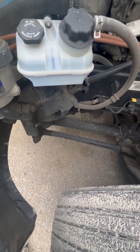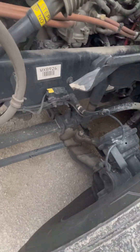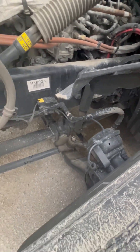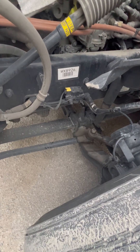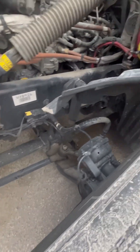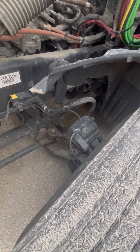I have my front and back spring mounts, my leaf spring, my u-bolts, and my shock absorber — all properly mounted, secured, not cracked, bent, or broken. The leaf spring is not shifted or twisted, and my shock absorber is not leaking.